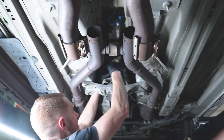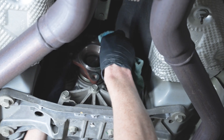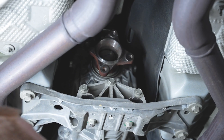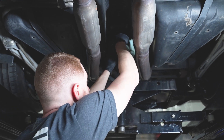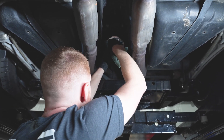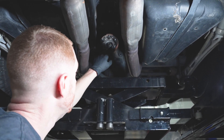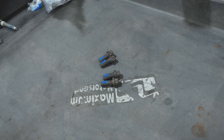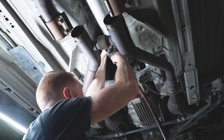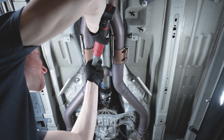Just make sure your flanges are clean. This car's been in Texas its whole life, so we don't have to deal with rusty, crusty issues much. You just want a good mating surface. Wipe any loose debris off the front and rear flange. If you have to use a green Scotch-Brite or wire brush, whatever means necessary, get it all cleaned out good — including the thread holes. Flanges are clear coated, we've got anti-seize where we need it. Now we'll work it back into the car, reinstall it, throw some Loctite on our front flange bolts, get all that installed, re-torque, and get the exhaust back on.